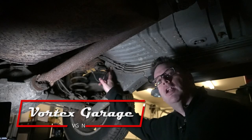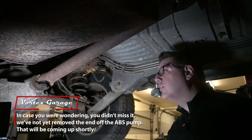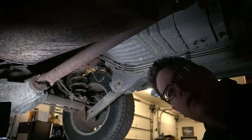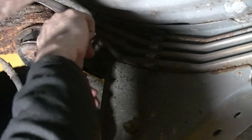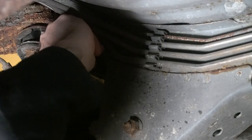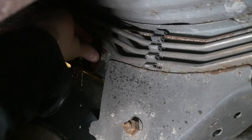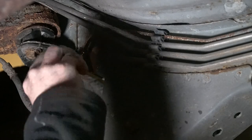Since we're back here, I've gone ahead and sprayed this with some penetrating oil and we're going to remove it. We're going to use a 3/8 flare wrench on top and hold the line so we don't twist or break anything, and we'll hold that with a 5/8. That was really easy — I feel like we got really lucky on that. Get your drain pan ready.